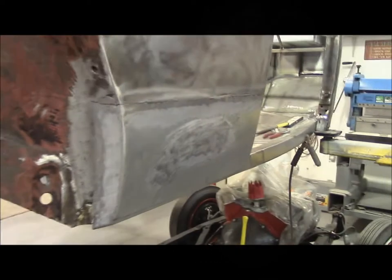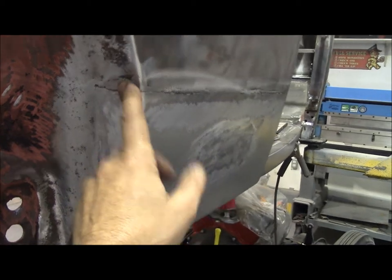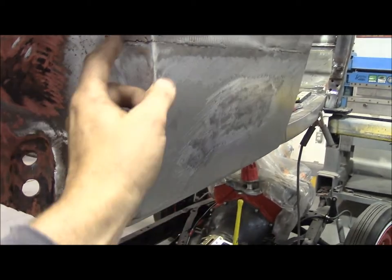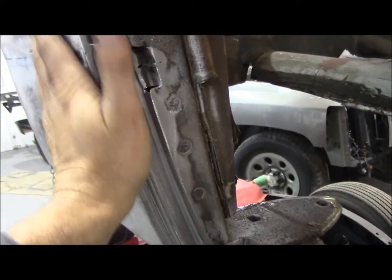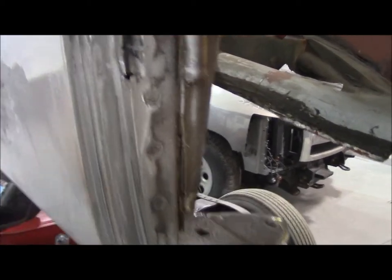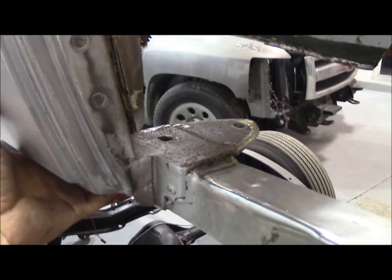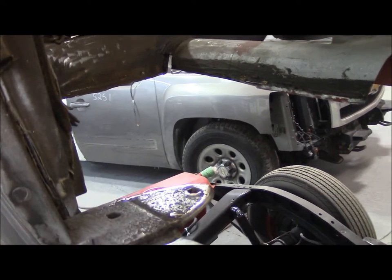Okay, and here it is guys — it's done and finished. You can see I made a little patch, put it up in here where it belonged, butt welded it all down here, did the cut, butt welded it, and it's all butt welded along here, solid as a rock. There's no oil canning. We got it all sealed up there, all butt welded in. So we'll do a little bit of body work later on in life and away we go. Now I can come around to the back side and get that all squared away, and then it looks like I can put this floor pan piece in.